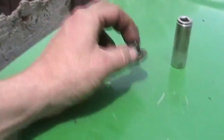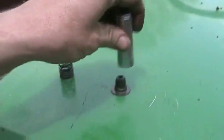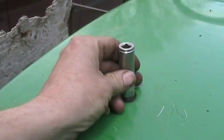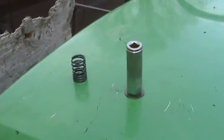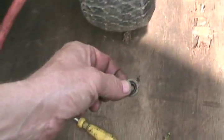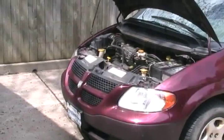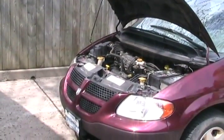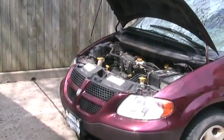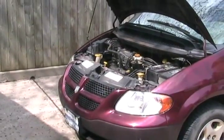To reinstall this type of valve seal, shove it back on top of the valve's guide. Get a socket that fits over top of it and tap it on nice and straight with a hammer until it hits bottom — then it's installed. Set your valve spring and tool back in place, put the retainer back on and the keepers, then slowly release the handle. Of course if you've got broken rings, bad rings, or a scored cylinder, you have to take the motor out to fix it. In most cases, sometimes you can take the oil pan off and the heads off and just pop the pistons up through the top.